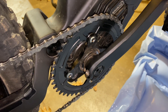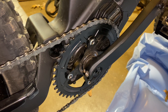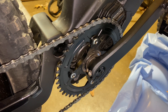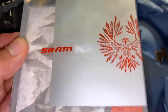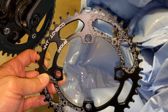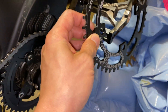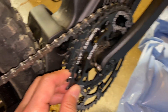The pedal assist will work past 25 miles an hour. I was able to get to 30 miles an hour and that was using the 13 tooth on the back. I plan to enable the 11 tooth. I also used this new SRAM NX Eagle 12-speed chain and I have not removed any links yet — it has 126 links. I also have this 44 tooth chainring that I saved from another project. I'm going to put it on here to show you what it looks like if you wanted to add another chain ring on the outside.